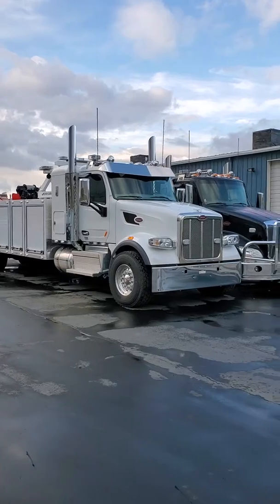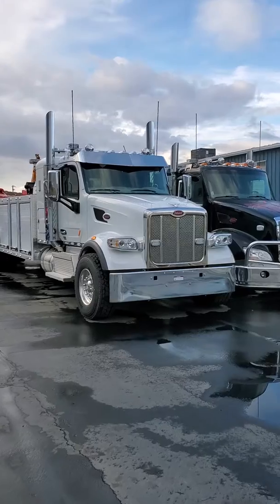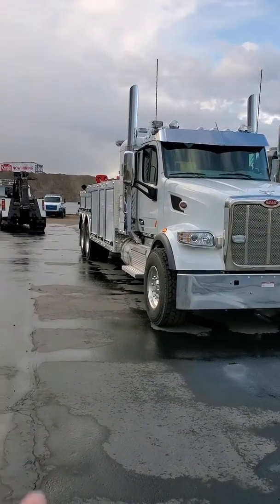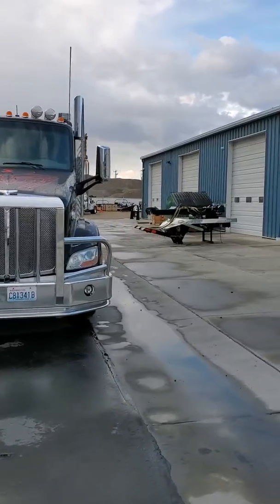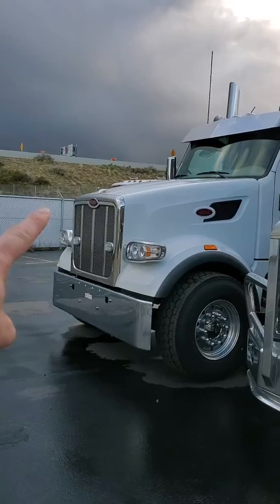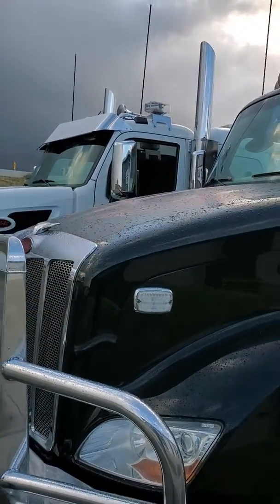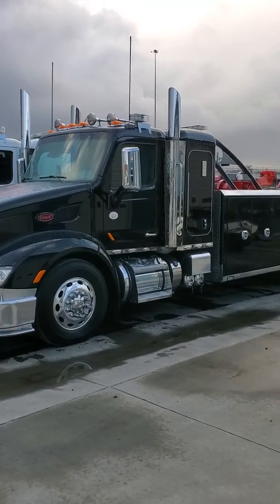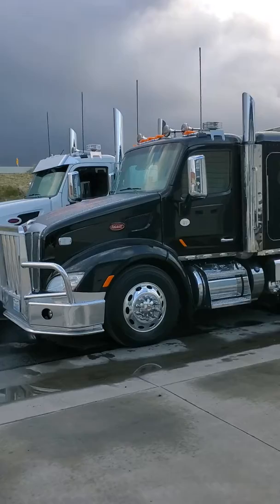This white chassis right here has a 565-horse Cummins with a 20,000-pound front axle and 46,000-pound rear axles. The black one is a 579 — just a one-digit difference. You can tell the difference by the hood line: the 567 is a little square on the front, while the 579 slopes forward. It has a setback front axle, and its wheelbase is only 300 inches — very respectable, but there are differences.